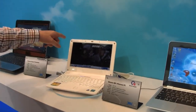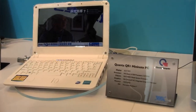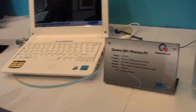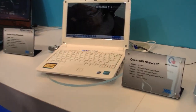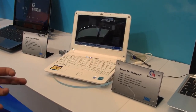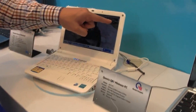It comes with a 10.1-inch display, 1024x600. It's a VIA Nano U1700 CPU with 1 GHz — that's the first generation of the VIA Nano, a single core architecture. And it comes with a VX855 chipset, which means it has an integrated VIA Chrome HC graphics processor doing a goddamn decent hardware acceleration of videos.